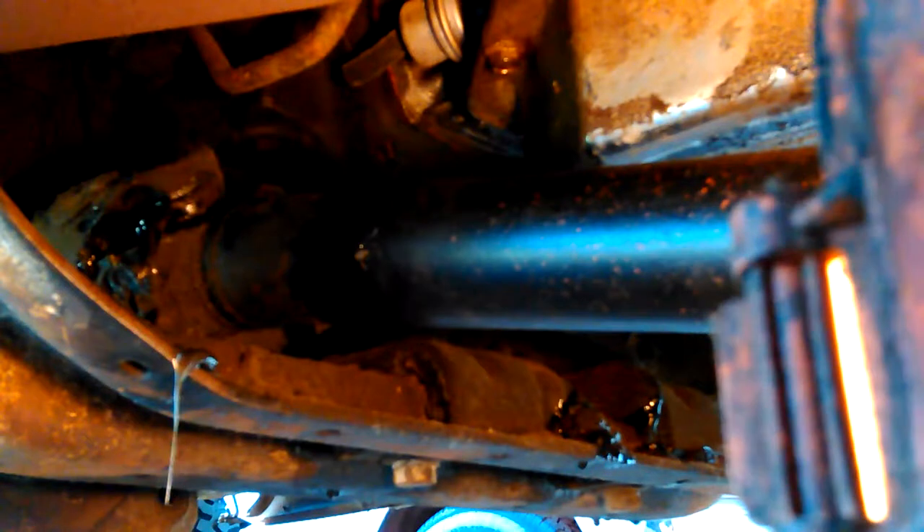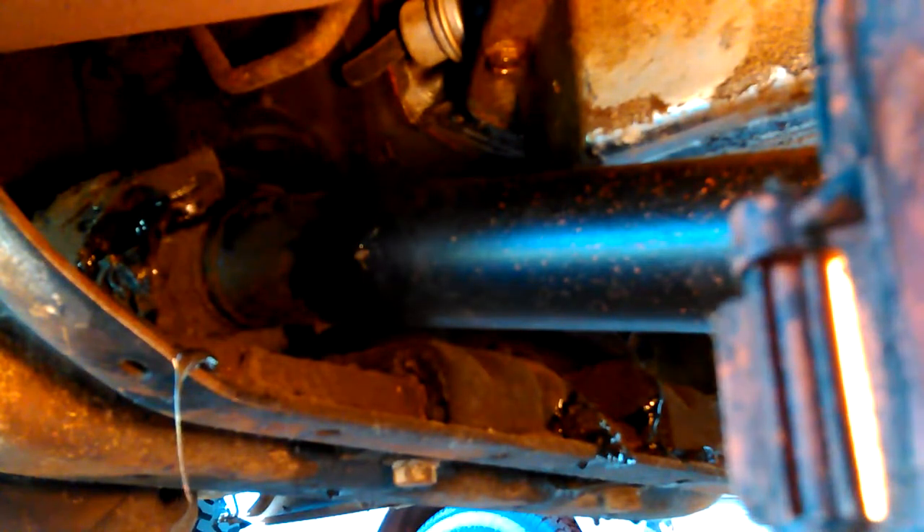I see the cross member that holds the transmission and transfer case up — it's in the way for any spot on the other side. So turning it won't help. Well, since this has not been used and I've never had them wear out on me, I may have to concede that I can't get to that one. It seems like I have before, since it's there — it makes me think I've succeeded before since it's not the standard type. When you start feeling pressure and it's hard to do, that usually means it's going in. If it was going in, that might have been enough. Quit wasting grease.